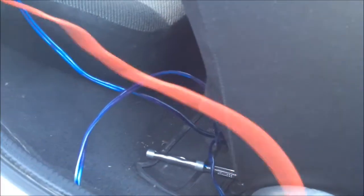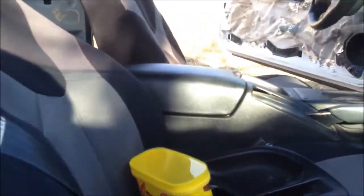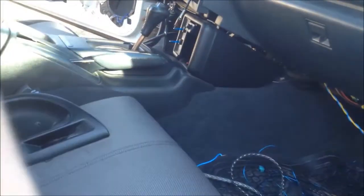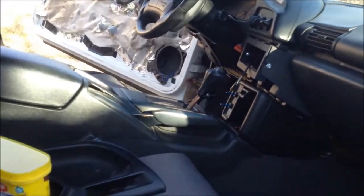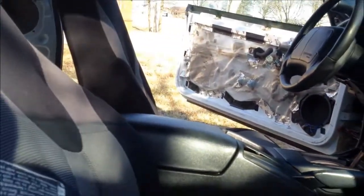This 12-volt wire turns my LEDs on — it's on a switch. I might run it to the back and put it on a relay and get some more LEDs, but this is pretty much adequate. It's got a 10-amp relay on it. I have LEDs underneath the floorboards on a dimmer in my center console. So yeah, that's another update. I'll get this video edited and uploaded. Looking pretty bare — see you in the next vid.